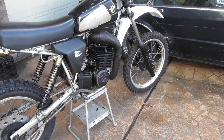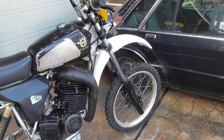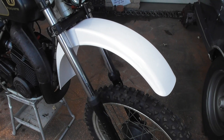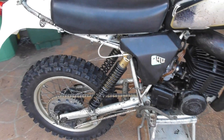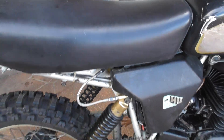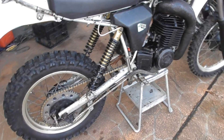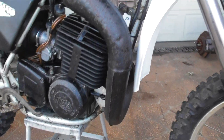The wheels I think are off an '84 model bike. The front has the twin leading shoe brake, and it does have the 40mm fork as well, which has been gone through by Promotor with springs and valves and such, so the suspension should be okay. The Ohlins are fresh — single spring, doesn't have the dual-rate spring — so yeah, they're fresh.